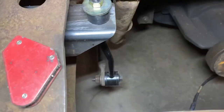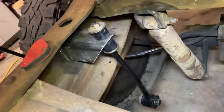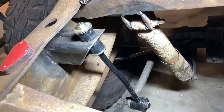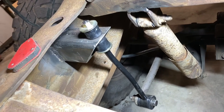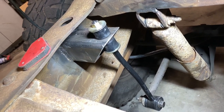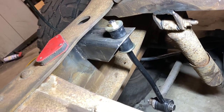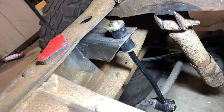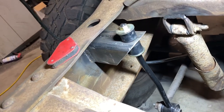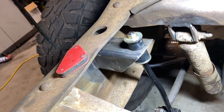I have a little offset, and I was able to make these mounts that you see here. Basically it's a piece of two-inch quarter-inch square tubing that I cut on a 45-degree angle and drilled it out so I could mount the sway bar end link to that.